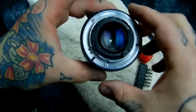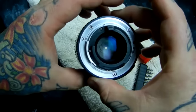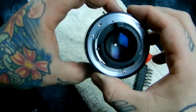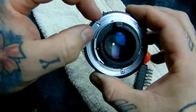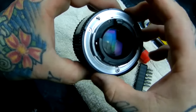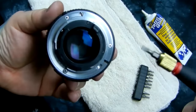These three screws are for the mounting plate, and underneath there's a tiny gear that interlaces with the autofocus for this lens — the entire lens assembly. It's this little gear right here. Underneath, it looks like a flathead screwdriver slot, but there's a set of teeth about a millimeter wide. The entire unit is about four millimeters along and it sits vertically like that.